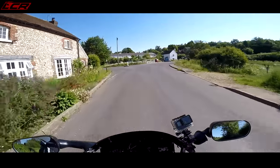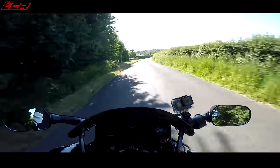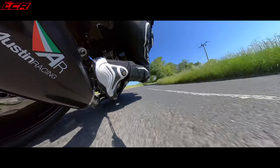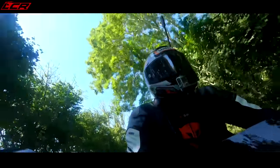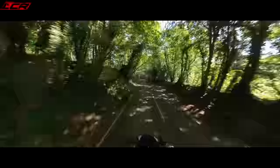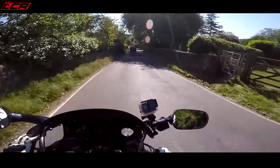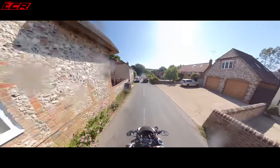The suspension is firm. This one's got the Öhlins aftermarket rear shock on it, and Öhlins front springs to improve the damping slightly. It's actually very well damped. What Adam has done is gear it down one at the front and two up on the rear, so he's really given this bike some bottom-end pull. It's got the full Akrapovič headers and an Austin Racing end can on it - it sounds beautiful, as nice as any bike you can buy today, if not perhaps a little bit better. This bike is not built to meet any Euro regulations - the setup is just all about performance.